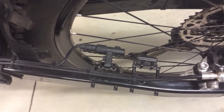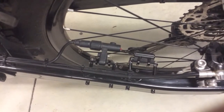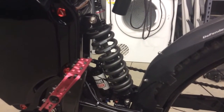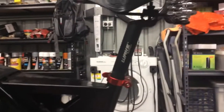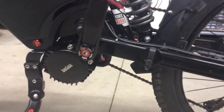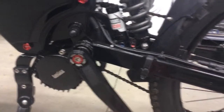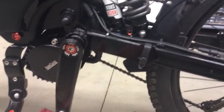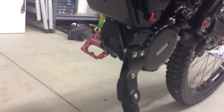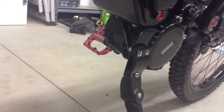There's a custom speed sensor mount for the BBS HD, and a custom Batman wattmeter mount — that's all landed in pretty nicely. Running a RockShox 240 by 76mm shock with a 600lb spring, which worked out nicely for me. There's a cheap Brooks suspension seatpost, and a custom motor mount bracket which took a few attempts to get right — it's held by the bottom bracket but also has a stainless steel hose clamp with heat shrink around it that locks into the swingarm. I also made a custom kickstand mount which mounts to the bottom part of the frame and just clears the motor nicely.